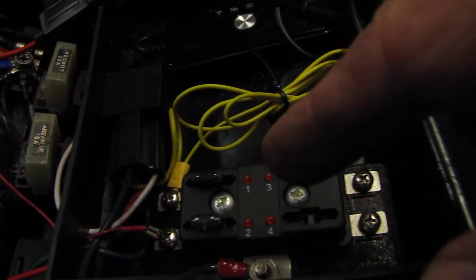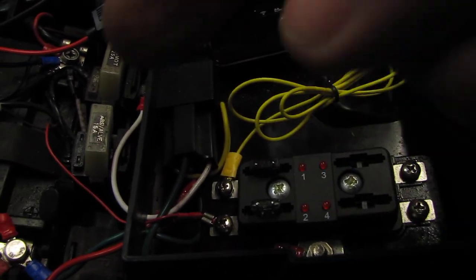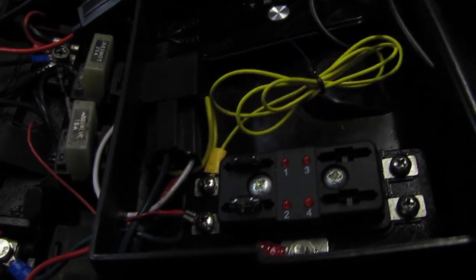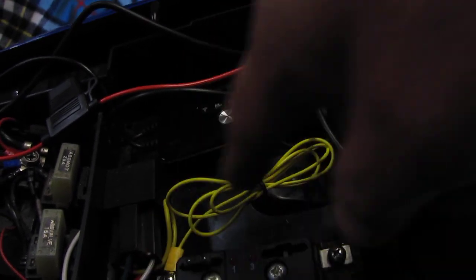And this is a little unit that I installed a couple of months ago with a friend of mine who helped me, and I run my sat nav, and I allowed myself 3 other takeoff points to give me a switched live point, which is covered by this relay just here. Okay, so that's a switch. So the whole system only works when the ignition comes on.